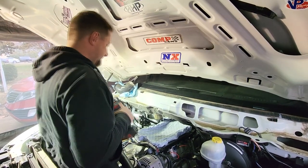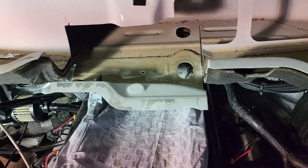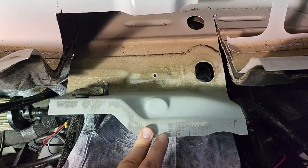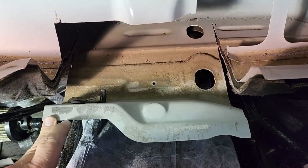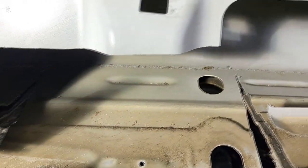All right, first cut down. All right, Mopar fam, we did some more cutting. We basically used a Sawzall with a long blade and we cut pretty far back, just to the very back of this cowl, under the windshield here, on both sides.